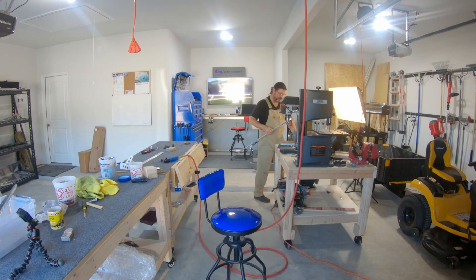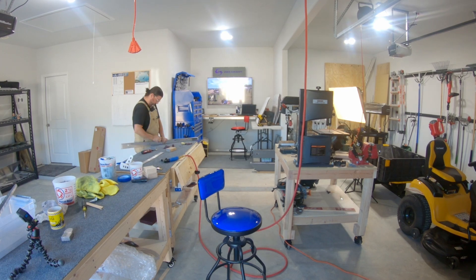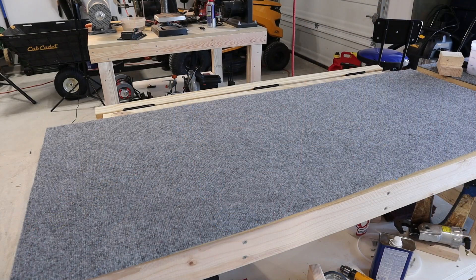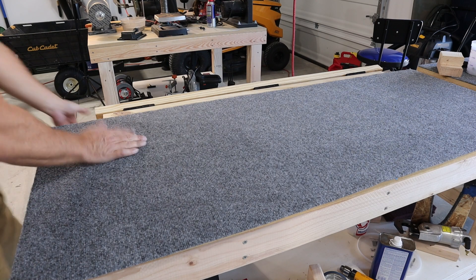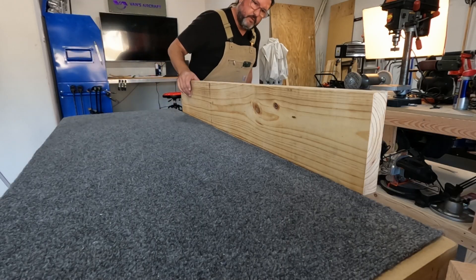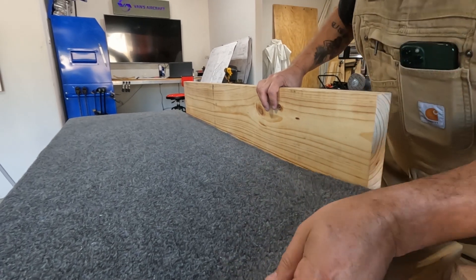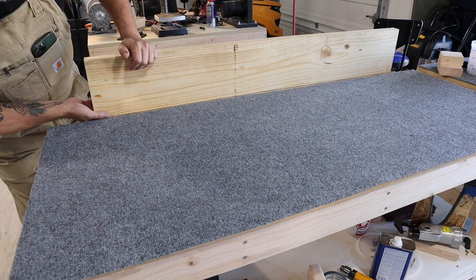I haven't talked in great detail about edge finishing and prep work, but it is a big part of the job. I've decided, since I live close to the gulf, that priming internal parts is probably a good idea. That wraps up this portion. Next up is a real-time view of bending the left elevator — the stiffeners have already been riveted on, and since the brake is already mounted, why not go ahead and do it.